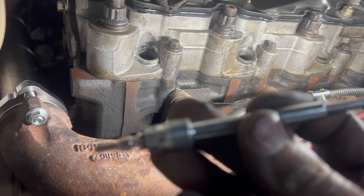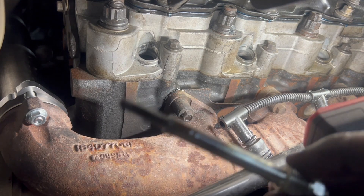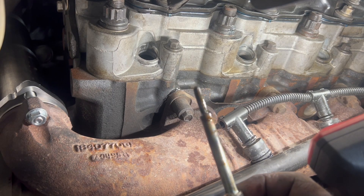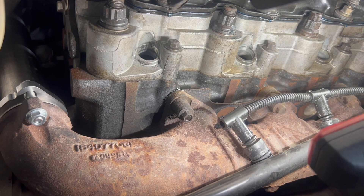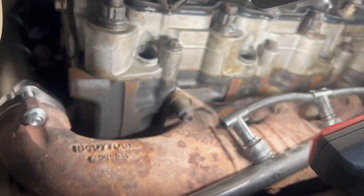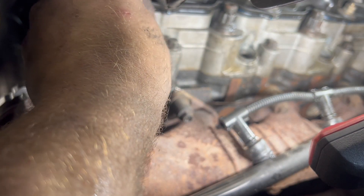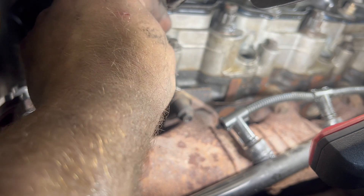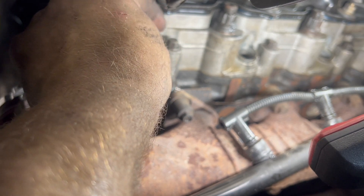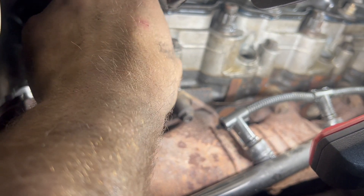Also make sure you run the right glow plugs. Here's the old glow plug — make sure it's whole, make sure the tip looks good on it, so you don't have anything to worry about. Here's your part number from Ford for your new glow plugs. Hand thread these in — don't do something stupid and run them in with even a hand ratchet. Do them with a socket like this, make sure they're right. We're just going to snug these up, get the new ones in one at a time, snugged up, and we're going to go back and torque them.